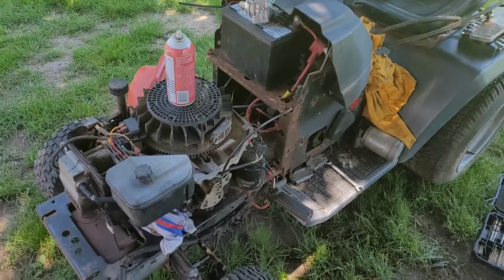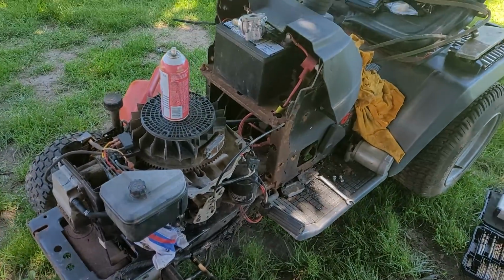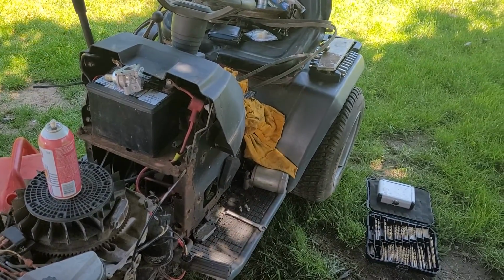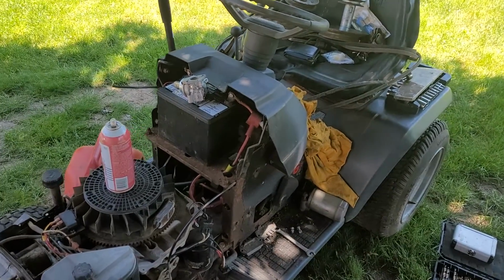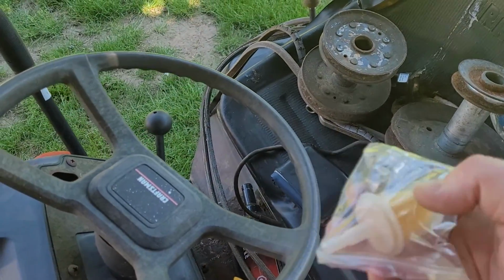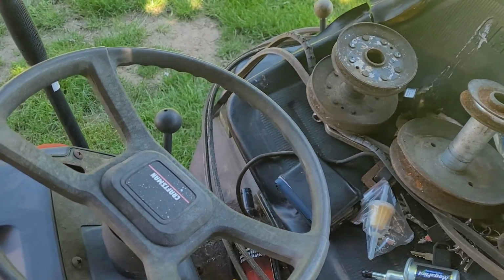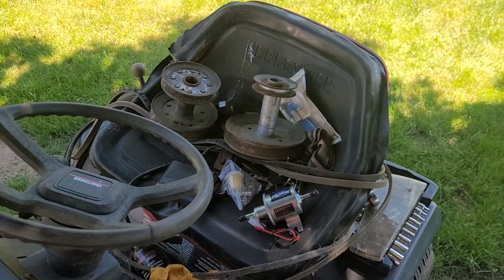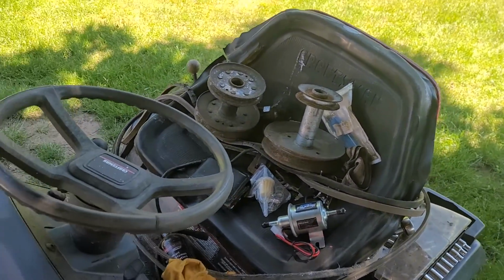These pumps here, about 29 bucks. I got 2 of them. One for this machine here, and either one for the racing lawnmower or one for the Cub Cadet, because it needs a new fuel pump. So I haven't yet decided what the second one's going to. But in the kit, it comes with a brand new fuel filter and clamps, which is nice. And they're the halfway decent clamps. So really, for 29 bucks, you're getting a usable, low pressure fuel pump. It's 2.5 to 4 psi. So that shouldn't overpower this engine.